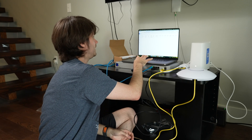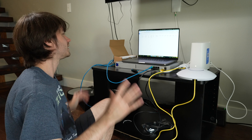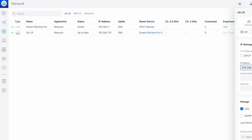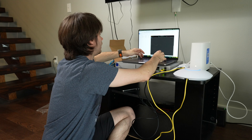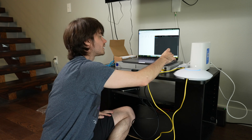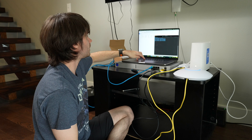The access point is showing up in the interface — I hit 'click to adopt' and it starts adopting. It's receiving packets and has been assigned IP 192.168.1.39 via DHCP. I go into settings to set that as a static IP address at 192.168.1.39. I then ping 192.168.1.39 to confirm, and it responds — so the static IP assignment looks good.